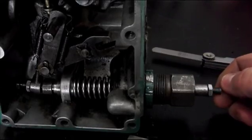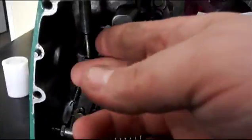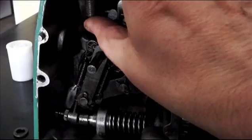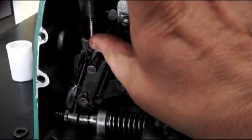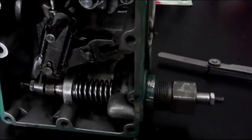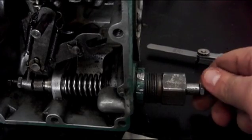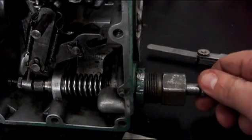If you do have the buffer screw up here, make sure that it's backed off. When you do tighten it and it makes contact, you don't want the engine RPM to increase more than about 15 RPM with that. That's not what it's for — it's not made for setting your idle. It's just the buffer.